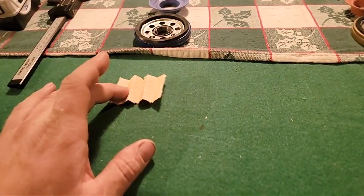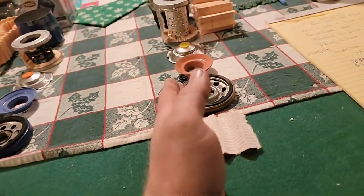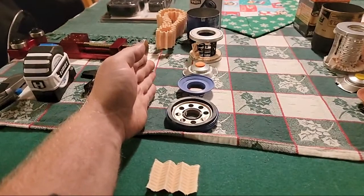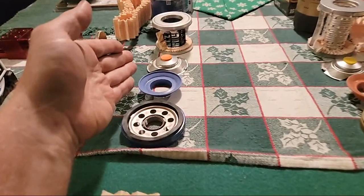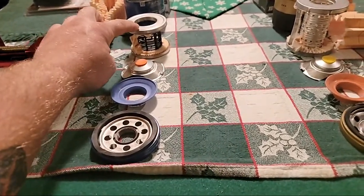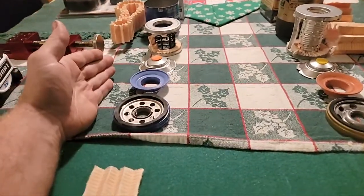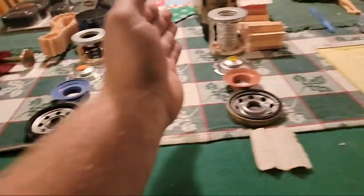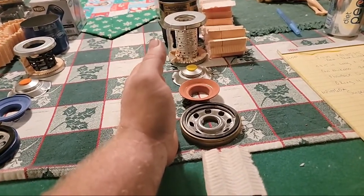That's what happened here. So this is 0.8 millimeters thick. This is 0.8 millimeters thick. This filter pleat is 53.5 inches long. This filter pleat here is only 52 inches long. This is 2.125 inches wide. This right here is 3 inches wide. You get a surface area on this one here of 110.5 inches. The filtering capability here is 160.5 inches of surface area.